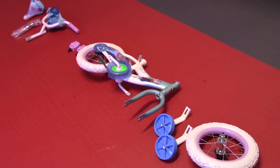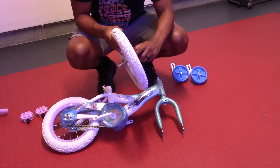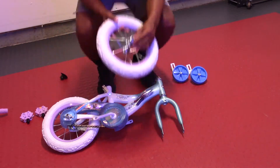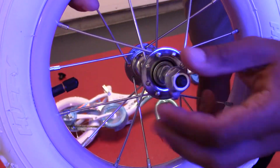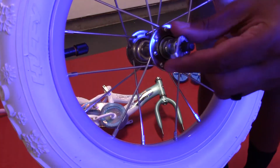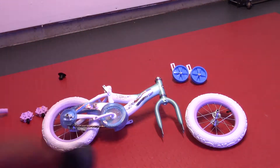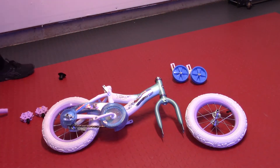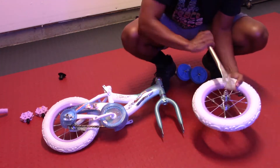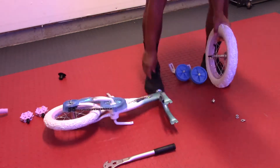If you have the space, lay it out like this — it keeps everything in order. I'm starting with the base of the bike that was already pre-assembled, attaching the front wheel. I'm taking off the protective cover to the nut and lock washer. You see on the lock washer there's a little inset and that locks right into the front fork of the bike. I'm taking the bike wrench and loosening the 15mm nut on the other side as well. There's also a lock washer on there.